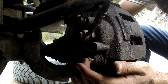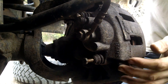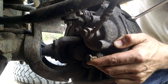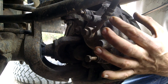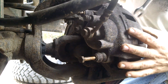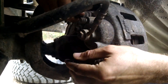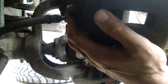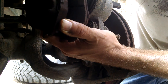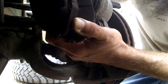Take off the two bolts from the caliper — that removes it, and that's where the brake pads are. One trick I do is compress the caliper just slightly. I'm pushing in the piston — there's a piston in here that pushes the brake pads together, which puts pressure on the rotor. So I'm releasing the brakes all the way. Usually one side comes out first. This caliper pushes the brake pads together and that's what stops the car. These pads are pretty good, but the pistons on the other side don't flow — I need to take them apart, sand them, clean them, and grease them.